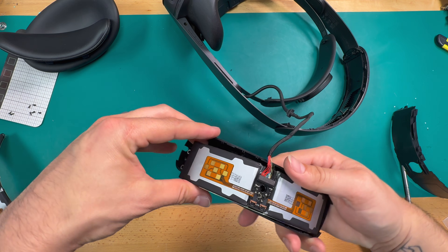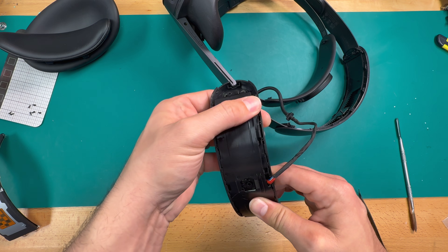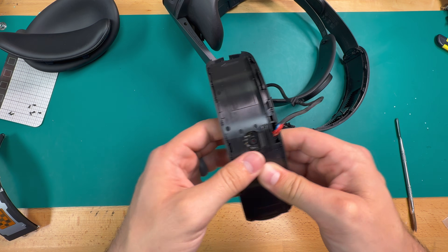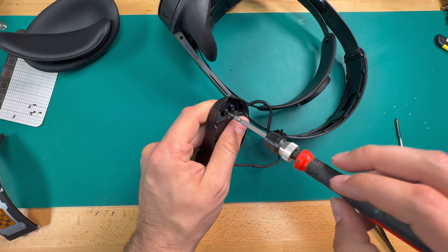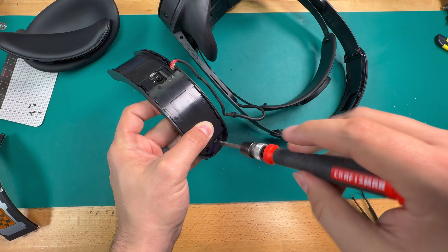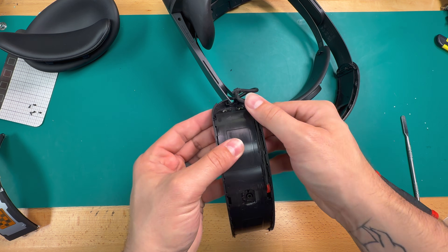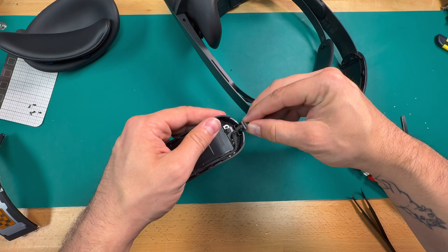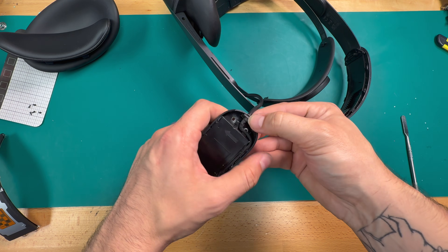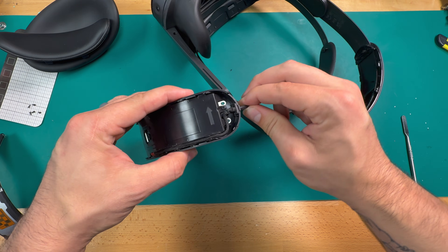Then we'll put our little battery clip back on, place the battery back into the compartment and line it up with the stud. Then put the top of this back on — it just clips into place. Now go ahead and take the screws and screw it back in. Then we need to run the cable back through these clips, make sure it's seated all the way in and flush inside the groove, because otherwise it won't sit right. The rubber stopper should prevent it from moving once it's seated back in place.